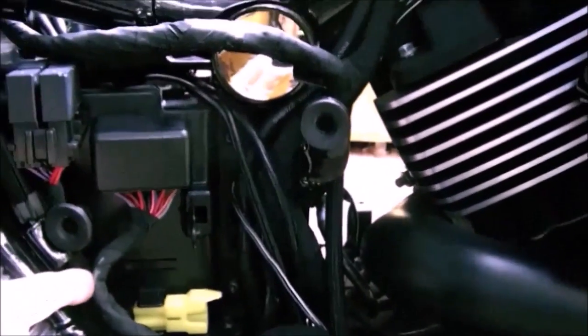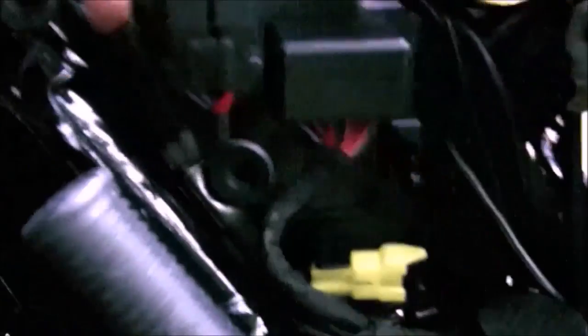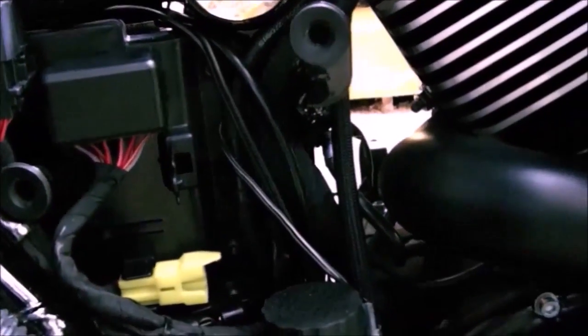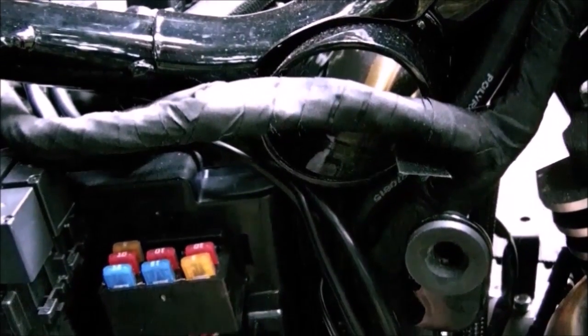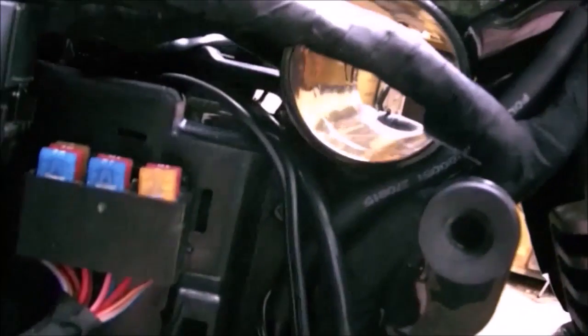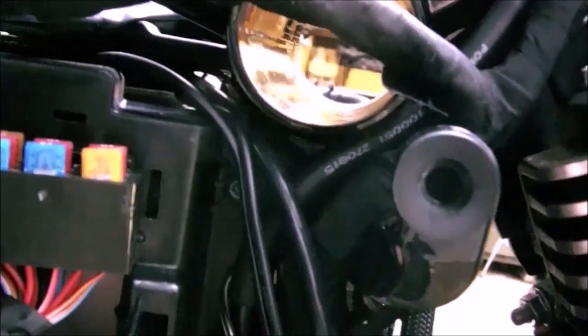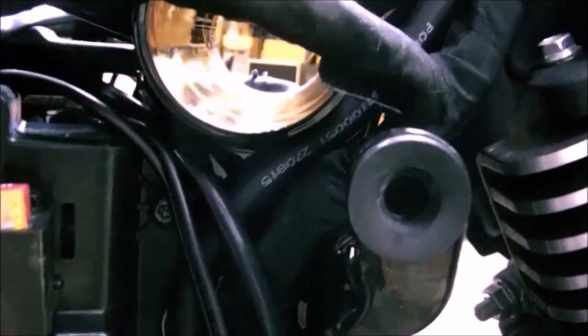All right, so we've got to lift all this stuff out of the way. That's the main fuse out. All this stuff's got to come out — the diode just pushes down out of the way. This is the fuse box; this cap squeezes, pulls forwards and comes off. Right, we've got to undo this screw here — and there's one down here. But before we do all that, I suppose we better undo the earth strap.